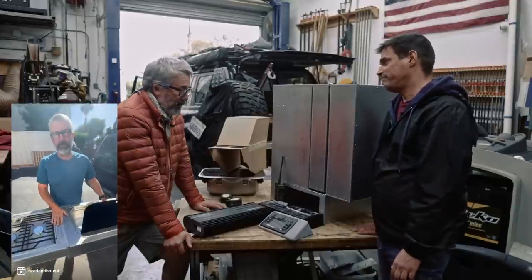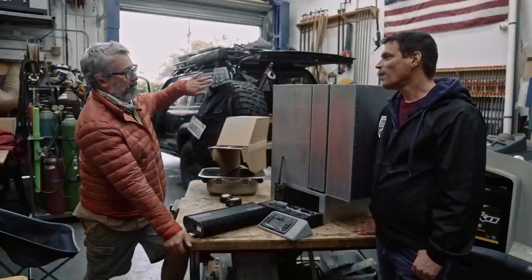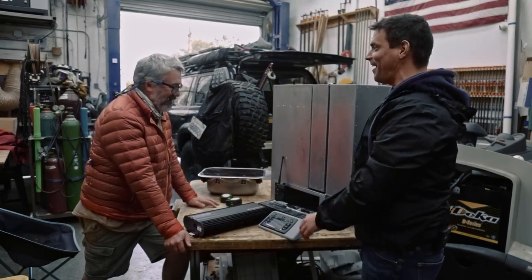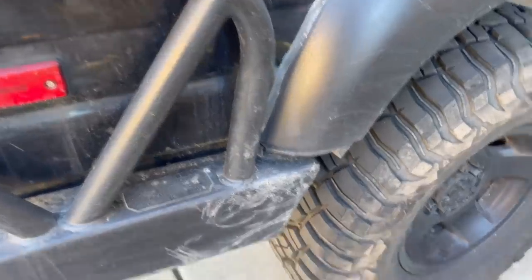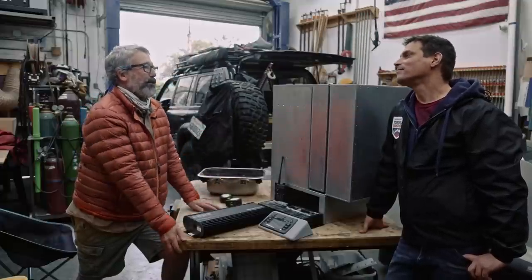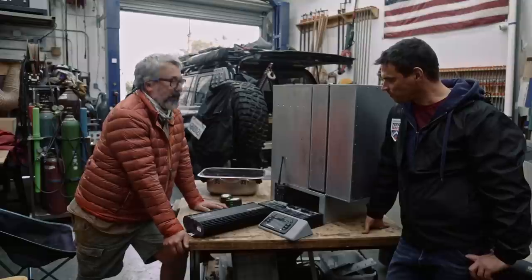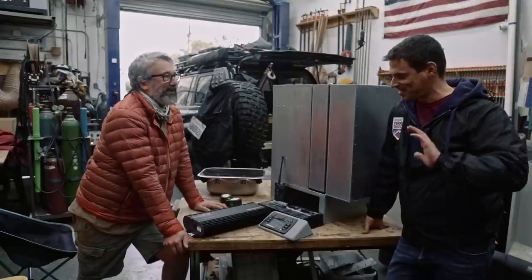What are we doing? Today we're going to get the cardboard mock-up of the front of the console against the existing dash. We've decided that's totally irrelevant — that's gone. So we're going to remove the parking brake. The parking brake will be electrically controlled underneath the vehicle with a solenoid, with a switch in the center console. That gives us like another five inches of room to actually have a real center console. And the parking brake doesn't work the way it is anyway — it's tired. If you guys are 80 series owners, time to redo it.